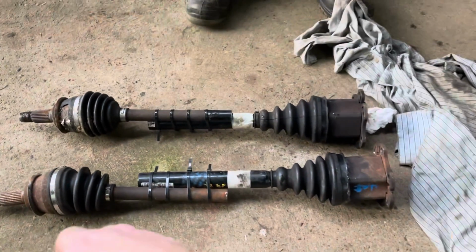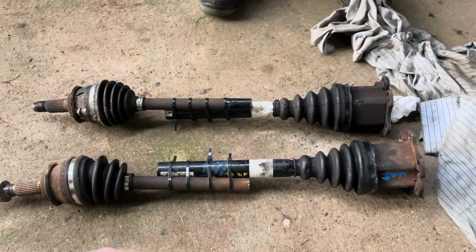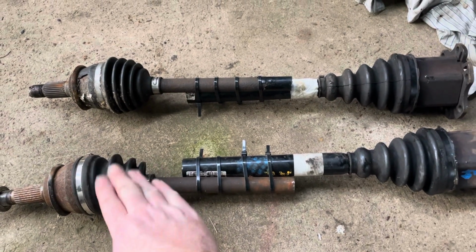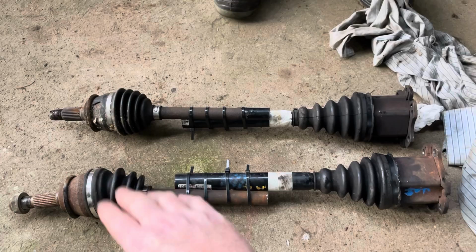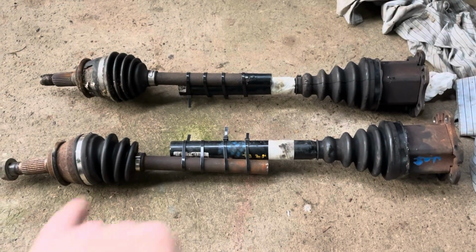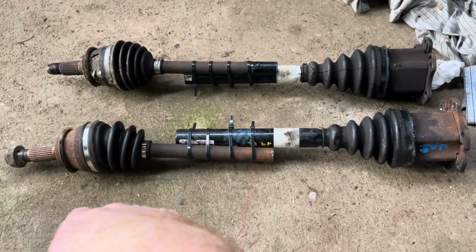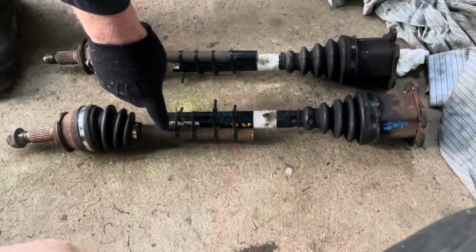The longer it is, more chances of being central, more alignment. And I'm thinking if we keep this very short here, there's less chance of any warpage on the welding. If there is a slight warp, it's going to be less than if you did it down here, if you see what I mean. And then we can decide whether we want to do any sort of bird mouth or anything silly on the joint.